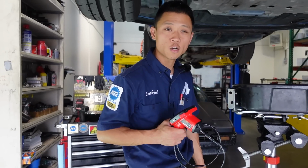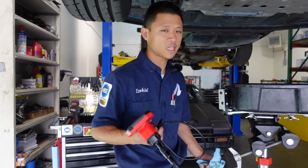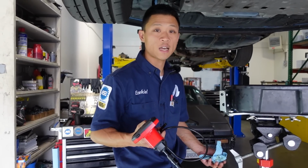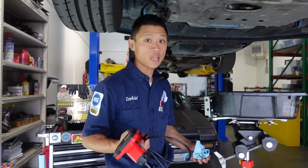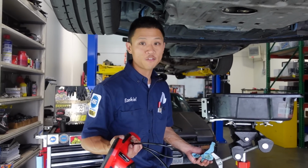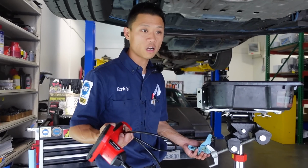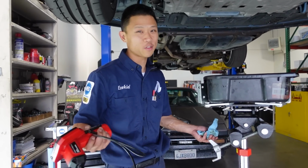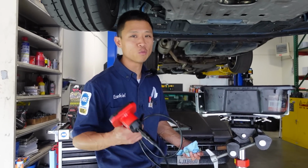All right, so you saw us look around the lower and the upper oil pan and around the oil pickup for excess silicone. Very fortunate, I can tell this customer, at least the upper and lower oil pan were not sealed with an excess amount of silicone. I didn't find any silicone hanging out in the oil pans, extra that broke off. So great news for the customer. I'm sure they'll be glad to hear it. We're done down here. Let's go back up. We'll cut open that oil filter, see what we find.